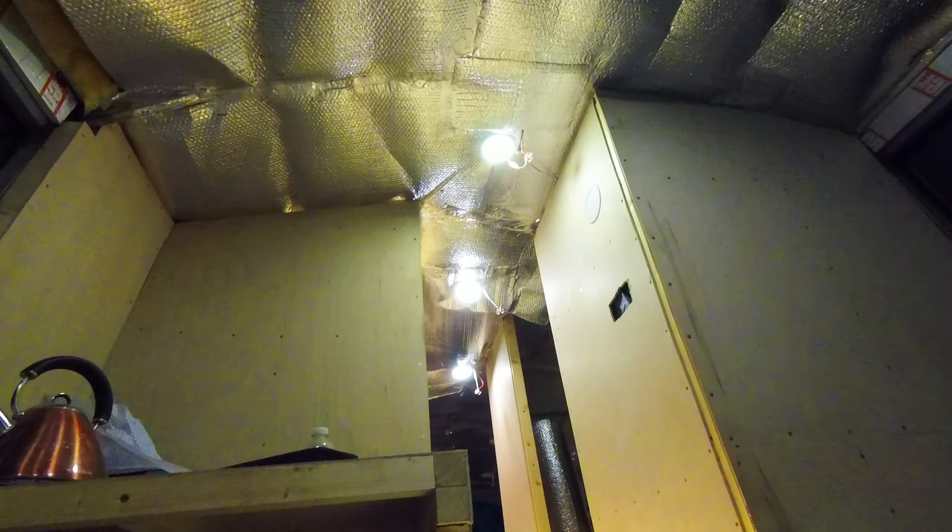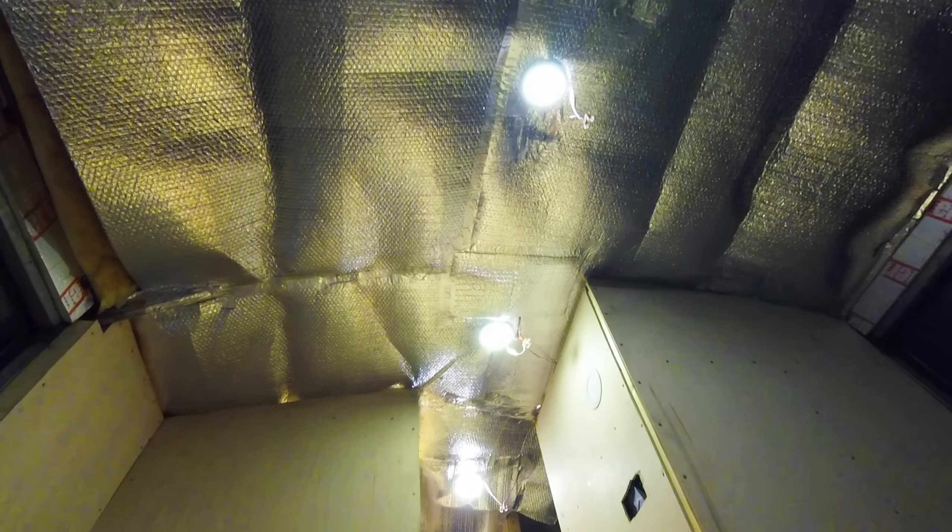Here's a good example of how the two different circuits are being used: the 24 volt circuit runs all the electronics, and anything heavy load is on the 48 volt. For example, all of the spotlights fitted at the moment are on the 48 volt system, but the strip lights in the floor run on the 24 volt system.